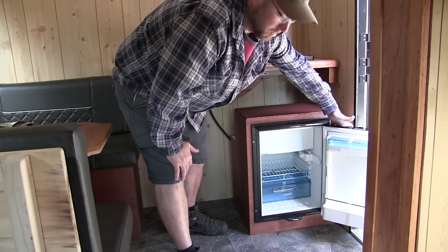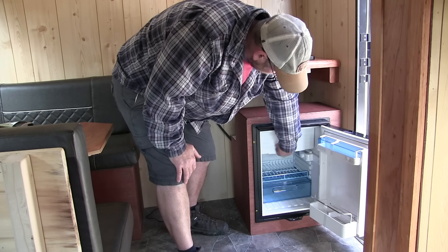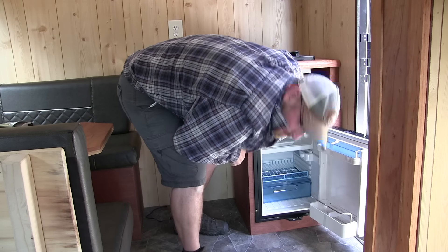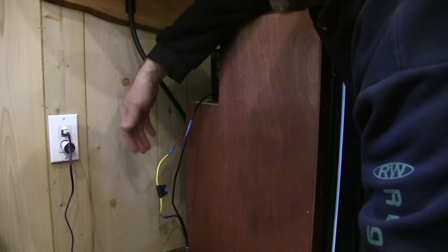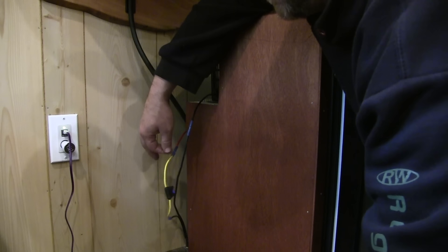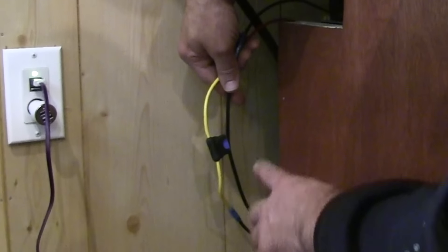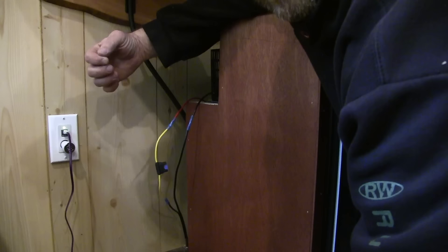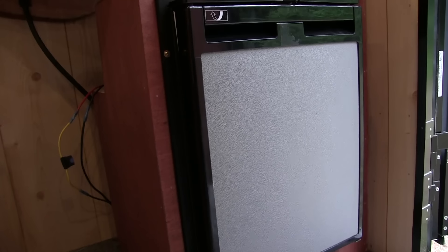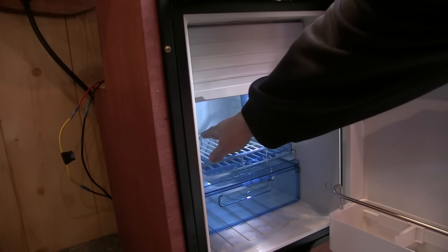It's just a little bitty fridge, but I don't plan on living in this camper so I think it'll be plenty for a nice little trip, and it does have a freezer — I might be able to fit some ice cream in there. I just want to show how I hooked up the refrigerator. Because it's a bigger appliance, they mentioned voltage drop and say not to run a switch in your wire. So what I did was run a new line directly to the battery, and I've got a fusible link. When I'm not using the camper I'm just going to pull this fuse out and that will kill the refrigerator and save my battery. There's the refrigerator — it's got power, nice and cool in there.